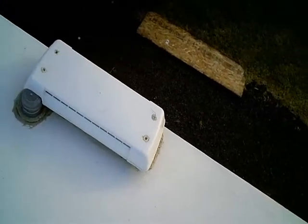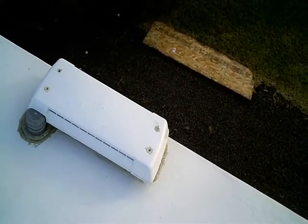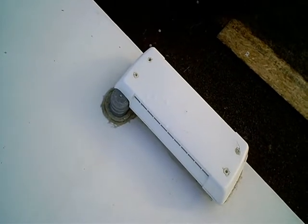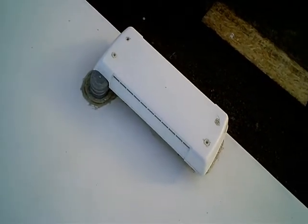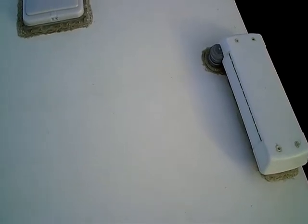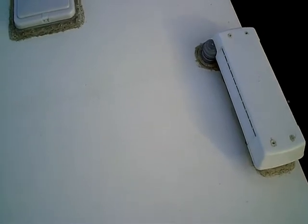I'll put a junction box here with conduit going over and running into the refrigerator vent. I've got some one-inch conduit — I'll pull the cap off the refrigerator vent, hit it with a hole saw, put a nut on it, and cut the hood to fit over the vent cap for the galley tank's vent line. It should be a good waterproof connection. That way I'll have a minimum run of the 10-gauge wire that comes with the solar lock or MC4 connectors, switching to higher gauge wire and keeping it shorter to minimize voltage drop.